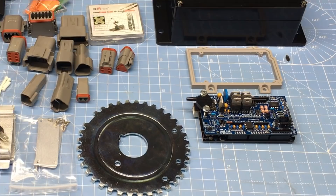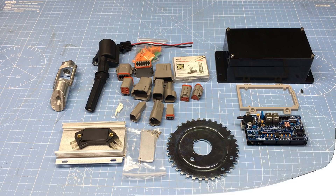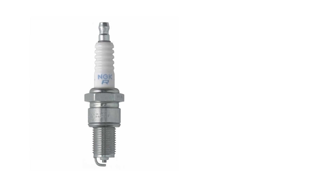This is where the Speeduino NO2C makes its appearance. The Speeduino EFI, along with the Arduino Mega, is a great value at about 85 bucks. The NO2C is extremely small and is the go-to ECU for one, two, and even four-cylinder engines — perfect for our application. As it turns out, fuel injection is easy. The hard part is igniting the fuel after it's injected in the engine, and that's where most people have trouble. So in order to get the engine running today, we're going to focus on creating the spark that causes the explosions inside the engine.